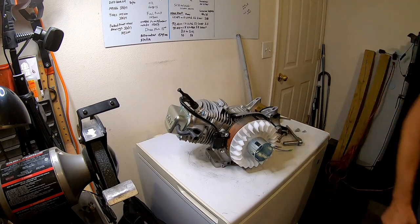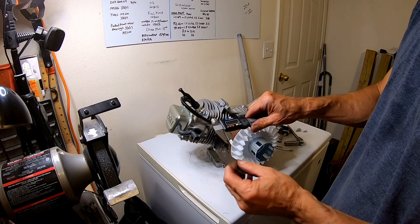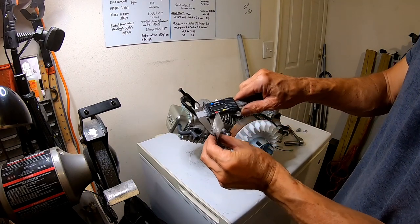Put the coil back on. To make it easy to put the coils back on, I just made up these sleeves. I'm going to set the gap around 30 thousandths because it's a stock magnet, so this one should be right around 30 thousandths.